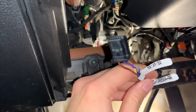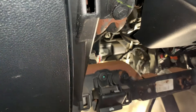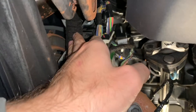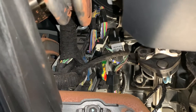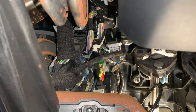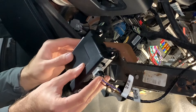This pigtail is the one that needs to plug into our module. We have plenty of length to go pretty much anywhere underneath the steering wheel here. I'm going to put the module right here. You see this cloth-covered bundle of wires — I'm going to zip tie the module right to that so that it's close by and attached to something that won't rattle.